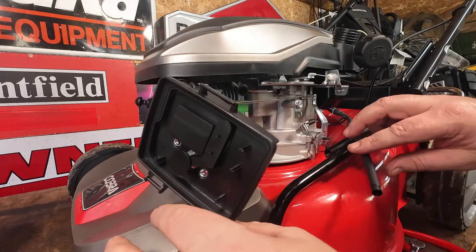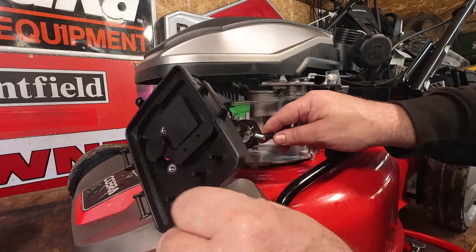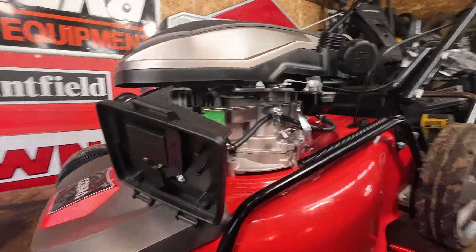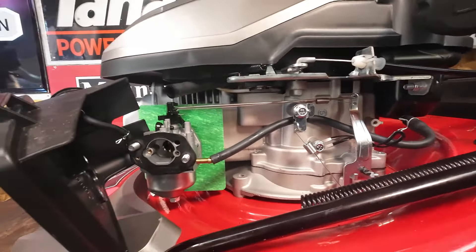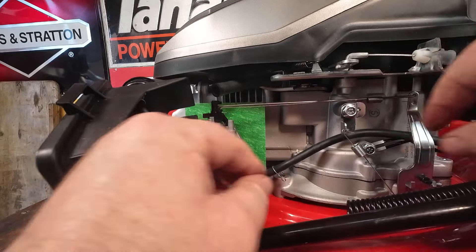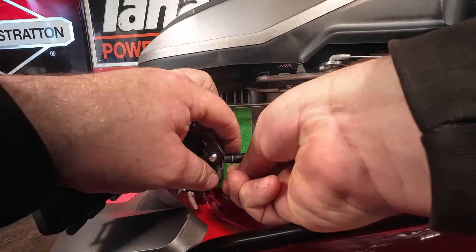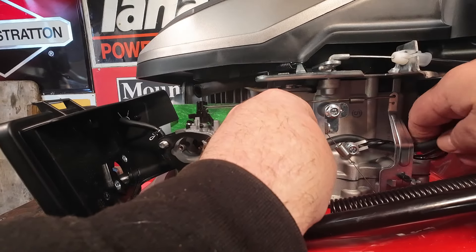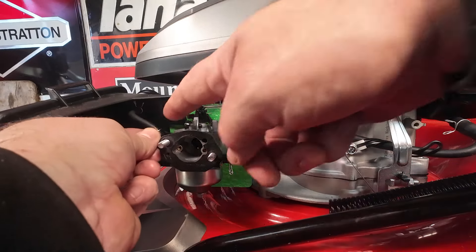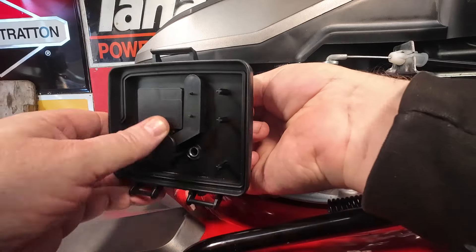Before I go any further, I want to bring my fuel pipe down and sneak my fuel pipe on — where's my little tiny clamp for that? Let me bring you guys round so you can see a bit more. So that goes on there, then we're going to slide our fuel pipe on and hook up our fuel line clip over the top. That sits on there. Tidy my fuel line up so everything is where it needs to be — push that away from the governor. So now I've got my fuel priming lead on — seat that clip down. As I swing this round, this pipe here has to go onto that one just there.